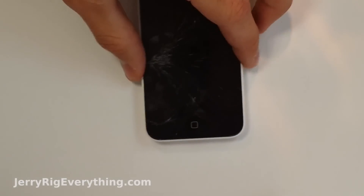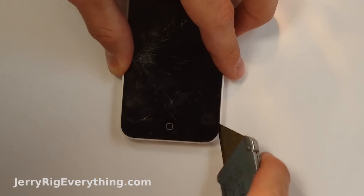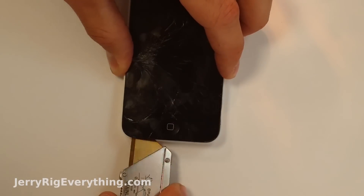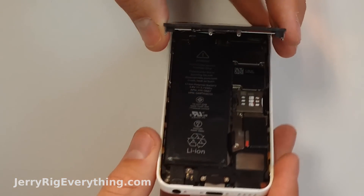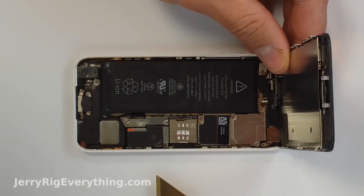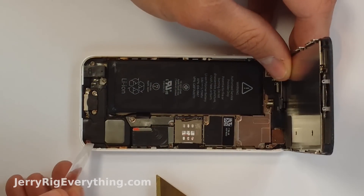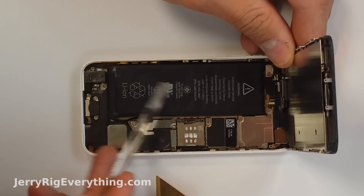Because the screen is cracked, I can't use my normal suction cup to lift the screen off after pulling out the bottom two screws. I'm going to show you a quick little trick that you can do with the razor blade — just make sure that you are gently prying up on the frame of the screen and not the glass itself. The frame is much more durable. You can see here that the water damage indicator is red, and the screws in the bottom left corner of the phone are starting to rust. This phone was completely submerged in water and has been dead for a while.